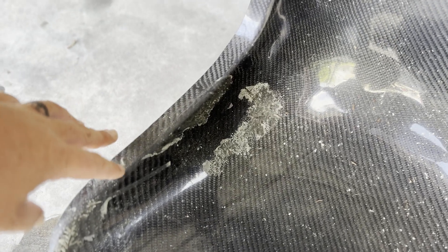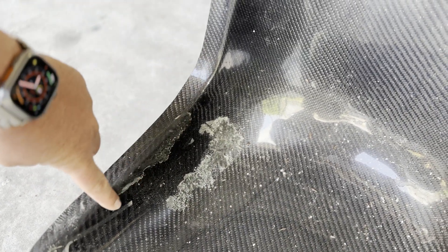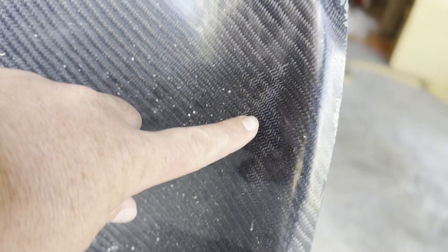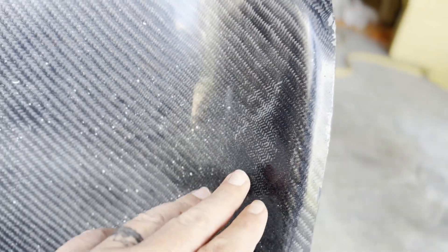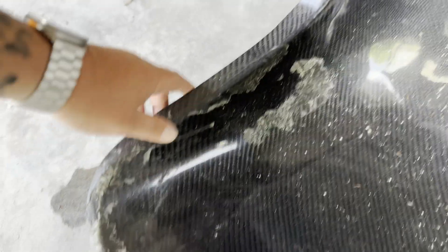The biggest thing we're going to do is start with a heavy aggressive sandpaper like 60 grit and sand this — but you're not really trying to flatten it, because if you have low spots where the clear coat or resin is missing you can actually sand into the fiber and it discolors it. When we put our top coats back on, sand it and polish it, you get an effect where the carbon fiber has been sanded into and it almost takes off half the weave. So instead of black and silver it only leaves the silver part behind. Unfortunately that would have to be re-skinned or a whole new part made to fix that.